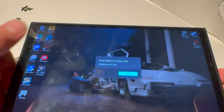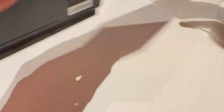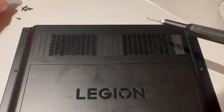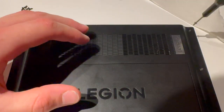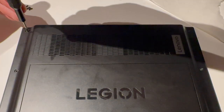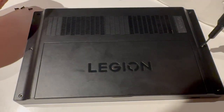Now test it — if it works, great. Some computers need to be charged before they can power on after internal work, like my laptop does that. So I'm going to charge this up and turn it on. I just charged it up a little to make sure it works and yes, it turned on. Mine was at 2% so there you go. I turned the fan on always-high and I do recommend you do the same, because the temps get really bad on the Legion Go, and having it always on high makes sure that you don't thermal throttle in any situation.